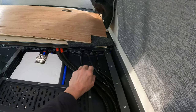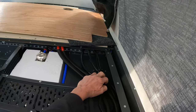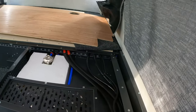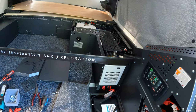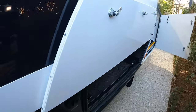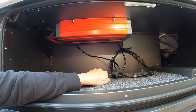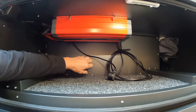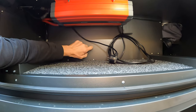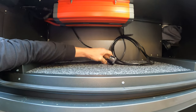The cables go through grommets into the next compartment. We've also got our data cable from the inverter for remote switching, and we're bringing back a cable for power into the rear of the cabin. The inverter is mounted onto the roof of the right-hand storage locker. I would have preferred to put it on the back so I don't lose storage height, but that panel is a little flimsy — it's only a backing panel for the sink plumbing.